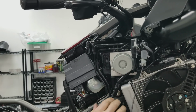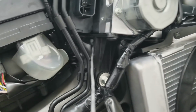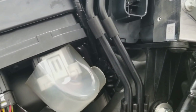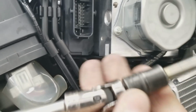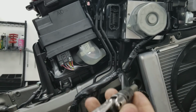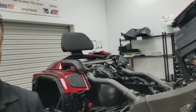And then, although you're probably not likely to be able to see it with the camera, we're going to put a tool up in this bore here to get to the upper shock bolt. Where you see the head of my magnet snaking in is where the upper shock bolt is. And to do that, the only thing we found effective is an 8 millimeter Allen. You need a universal joint. You're just pretty much going to have one. It's tricky to get it to lay up in there. You need to be 100% certain it's totally engaged, and that's how you're going to hold the shock bolt.